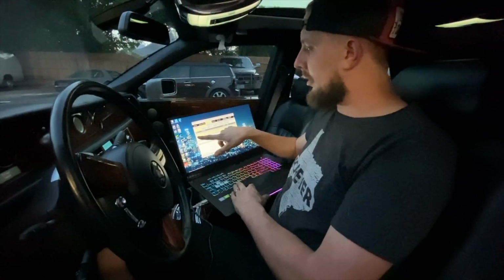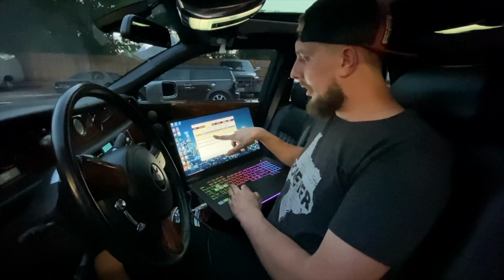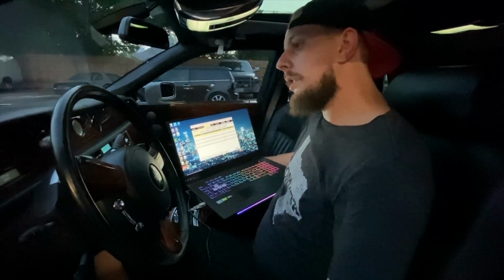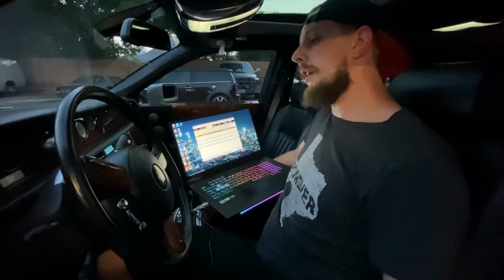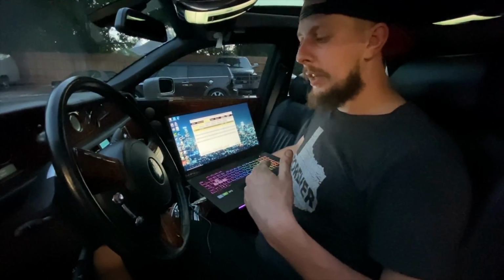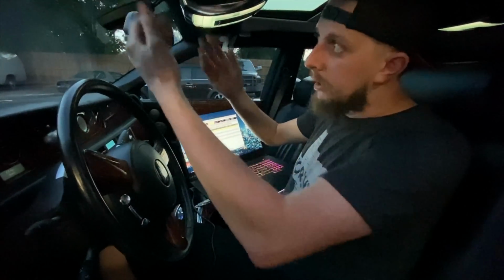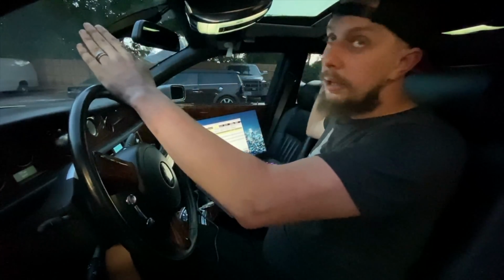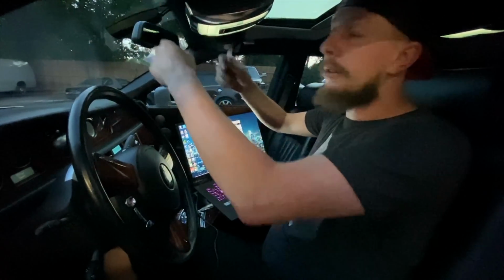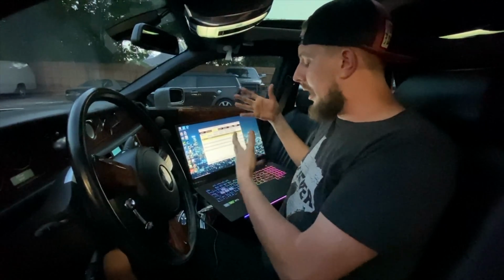S0200 and S0202. I know I was getting some weird things, like it was telling me the hood was open when it wasn't, telling me that door over there was open when it wasn't. That's the downside about CAN bus, and the positive is that it requires a lot less wiring throughout the car because stuff can be concurrent. But it's serialized. It's like a telephone pole. You can have just one line coming to yours and it carries it all the way down, but if you get a break right here, all those people down there are screwed. They're not getting electricity. Kind of the same idea.